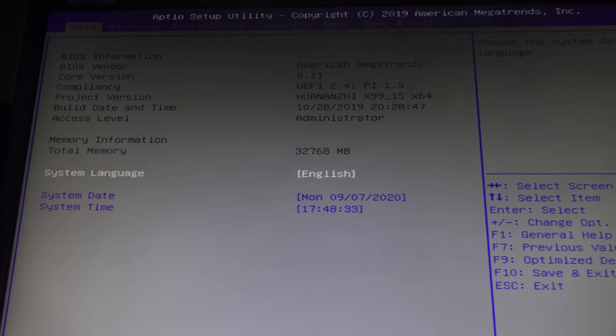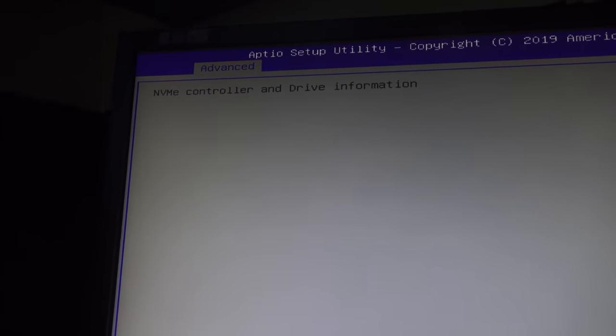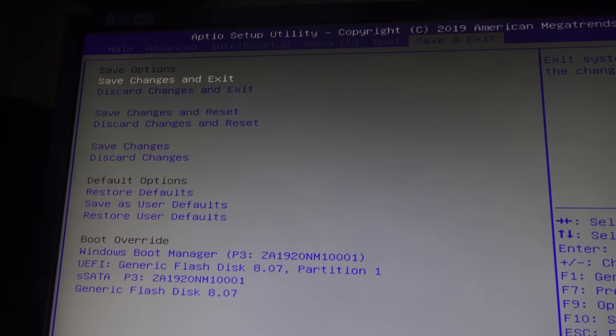The hardware numbers coming out of this motherboard are actually quite impressive. Regarding the BIOS — it's pretty basic, reminds me of the X58 BIOSes where you couldn't use a mouse but all your features are there: boot menu, CSM enable, secure boot disable — all baked in. However, there's no real overclocking support, though I've heard of people loading custom overclocked BIOSes into these boards that would do well with a six-core like the 5820K. Just make sure you keep the CPU direct draw under about 150 watts — after that, this VRM would start feeling a lot of pressure.